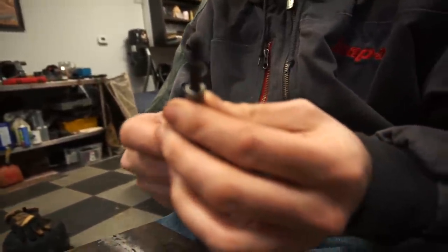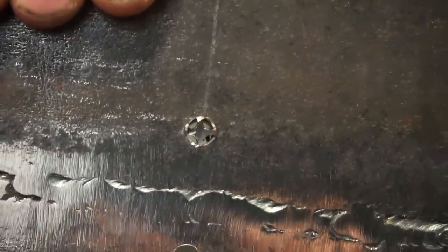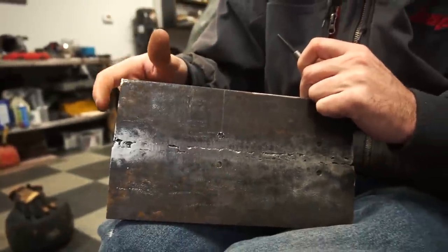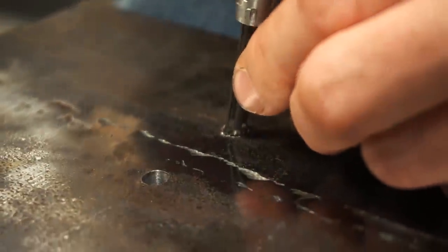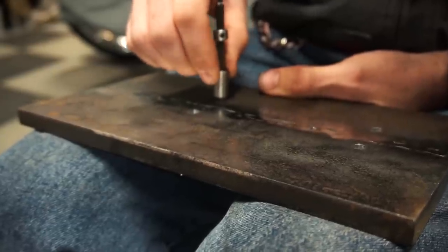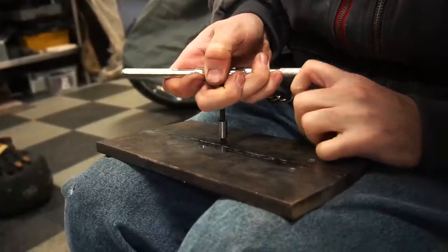Well, not a bolt extractor. I've got a tap extractor. It's got four little pieces here that are supposed to grab the little cavities on the tap. Yeah, those allow the metal to kind of, once it gets cut in, fall through those little slots. Gives it space. So this is used to reach into the slots. This, of course, is never a sure thing because they like to break. You push that down, then you twist on it. Please work. Please work. Please work.